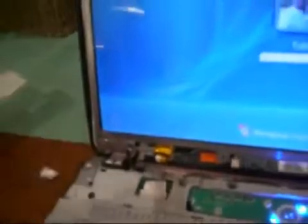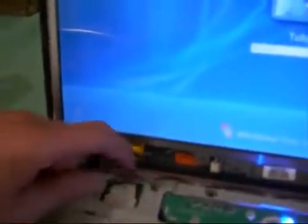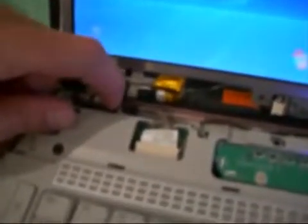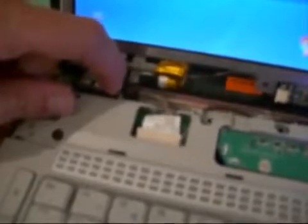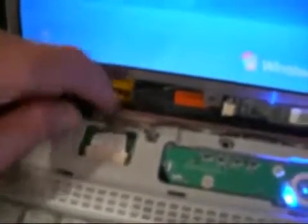I've actually re-seated this. I noticed last time I took it apart — because I take it apart every couple of days now to sort this cable out — that when I pulled it that way, it was causing screen flicker. If you have a look at the way the cable — I'll just pull the camera out a bit — you can see the cable's pulling on the socket there, on the plug thing there, and that's what was causing the problem.